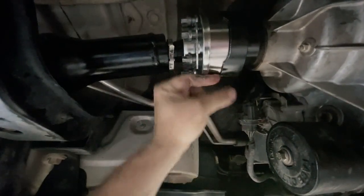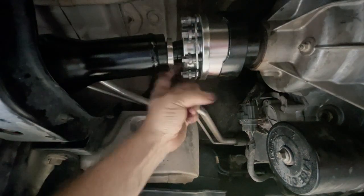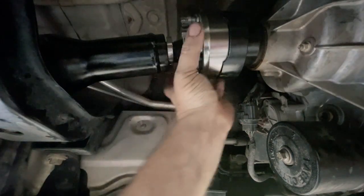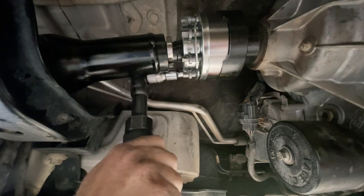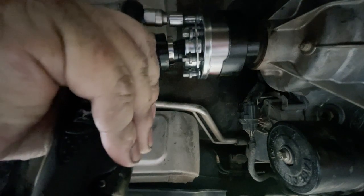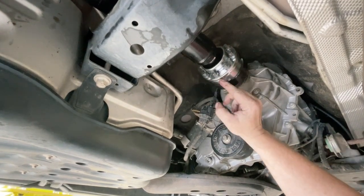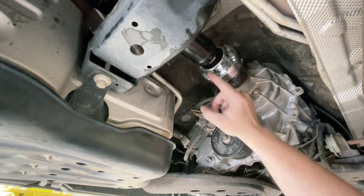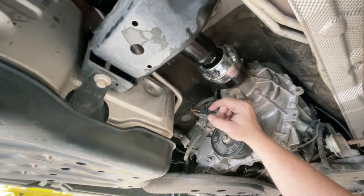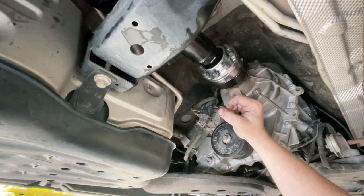You can see these bolts are quite long - they do have a lot to go through. Make sure that everything is going in evenly. I've just done these finger tight and I'm now just going to start tightening them up, ever so lightly, keeping going opposite sides just so that this joint pulls in and pulls together evenly. The battery went flat on the camera and I've missed some steps here, but let me just catch you up: put all the bolts in, tightened them down evenly to pull this into the flange evenly, and we've done up the strap for this boot. I don't have the torque specs for these, so I've just used a bit of common sense. Any comments or questions, make sure you leave them below. I'll put the part number for this in the description as well - thanks for watching.